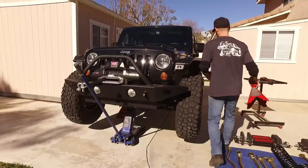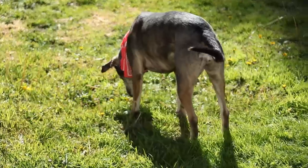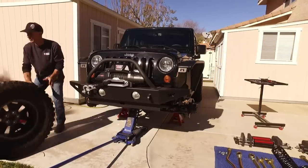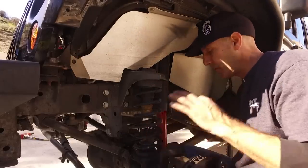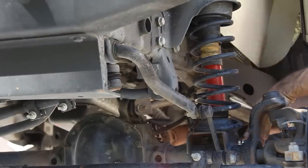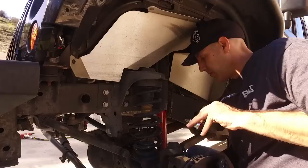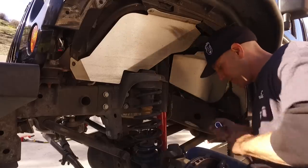To get started, lift the Jeep, put it on jack stands and make it safe. At this point we're basically going to try to disassemble the front suspension pieces and get our axle to droop. Before you do that, you want to make sure you take care of some of the more fragile bits like the brake lines and the anti-lock sensor. So we'll take the brackets off that mount those things, and that way we don't cause any damage as we make room for the good stuff. Save all of your hardware at this point because some of it gets reused and some of it doesn't.